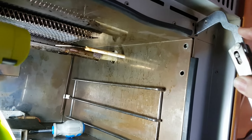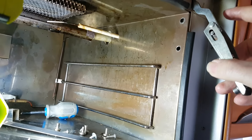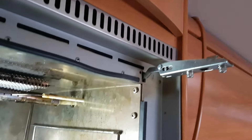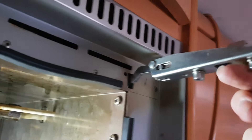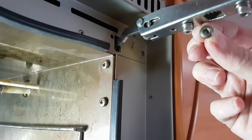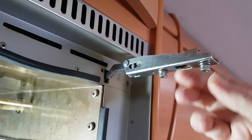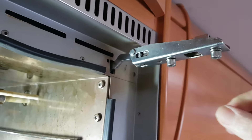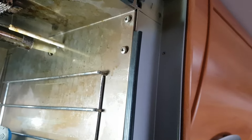So I'm going to start on the assembly process starting with fitting the hinges. Okay so they're both fitted — there's the one on the other side. What I've also done is replace these original Torx bolts — these are T25 Torx — with M4 Allen bolts. That just makes it easier when it comes to putting the oven door back on.